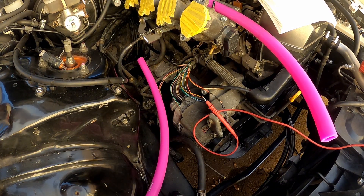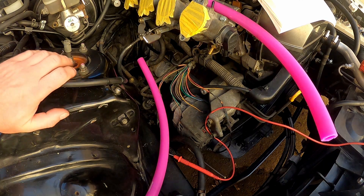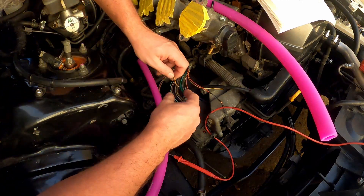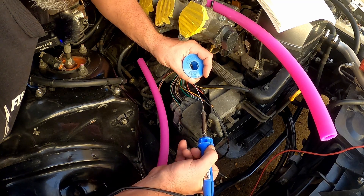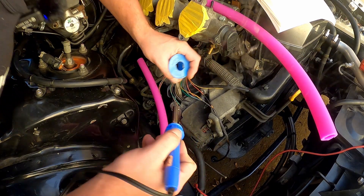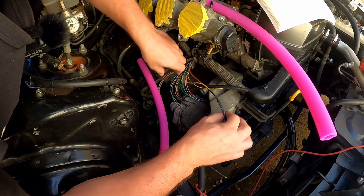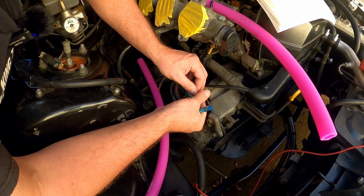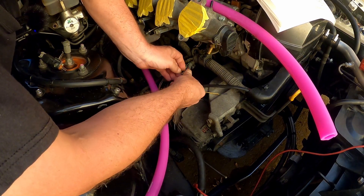I've got a motorcycle and I rev the thing. Uh oh. I smell burning. Maybe I stepped on the soldering iron. Oh, sure did. Wow, that's lucky. Don't step on the soldering iron. Feed that on there. Wrap this around. Okay, put some solder on there. Create a heat bridge - get in and out as fast as you can. Give it a good old look. Yeah, that looks good. I probably should have cut those to be exactly the same length, but Suzuki doesn't do that, so we're not going to worry about it too much.